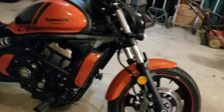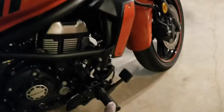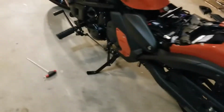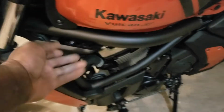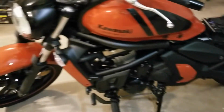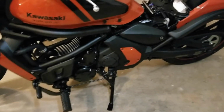Okay, so far, took the seat cover off, took a little piece off at the front, took this off to cut back a little bit so I can kind of get up underneath here. I've already cleaned everything down with the ISO heat. Had a hard time trying to get this one off, though. Couldn't get the bolt to come off. And like I said, bent this back just a little bit so I can get back up underneath here. Now I'm about to start from the front with the 3M promoter, put it on, and then start installing the lights in different places.